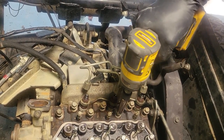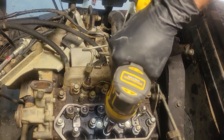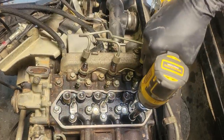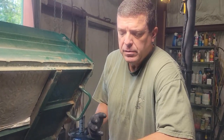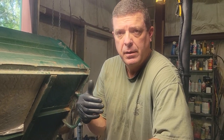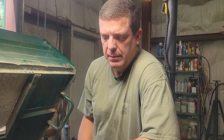I'm going to start by just running them down — I don't want to torque them yet, just get it closed. Then we're going to torque our head starting with 10 foot-pounds on all bolts, starting from the center and alternating back and forth, working our way out to the outside of the head. We're going to start at 10 foot-pounds, then go to 25 — I believe 25 is what's in the spec — and I'll bring it up to about 27 or 28 by the time I'm done.